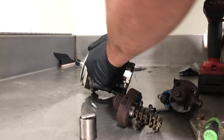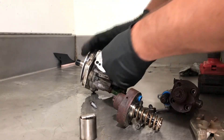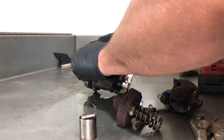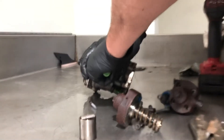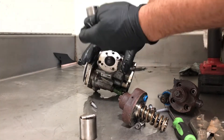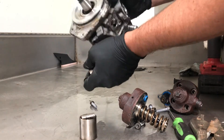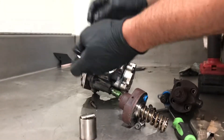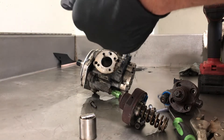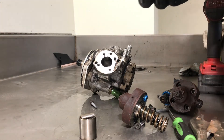What you can do to prevent it is a lift pump, add some additive to your fuel to increase lubrication, or do a CP3 conversion. We sell them on the website — they're $1,700 or so. I use this company SDP; they make a well put together kit, easy to install if you know what you're doing.